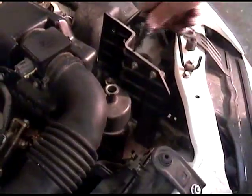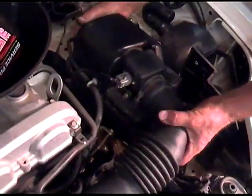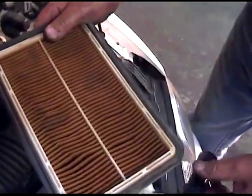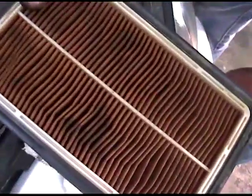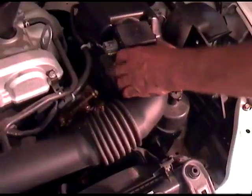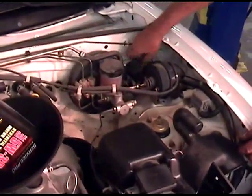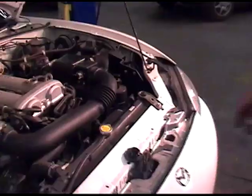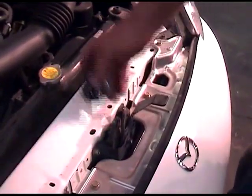Power steering — twist it off, clean it off, back out, full, top of the X's. Air filter: on the 99, two clips make it easy. The air filter looks pretty bad. Let's see if we can see any light coming through — not very much. A new air filter lets light through clearly. Clogged air filter versus a fresh air filter — big difference. Let's check that clutch master cylinder — fluid's good. Last of the four quarts going in.